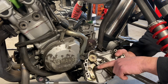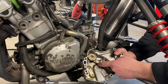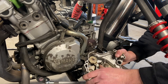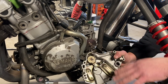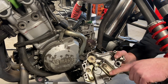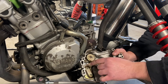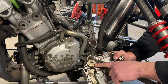On a hydraulic system with a master cylinder, if the pedal's all the way out, this is all the way in — you don't have to fuss with it. The only thing you have to mess with is how much your clutch releases. There's a lot of travel here, so you can overstroke your clutch, which is why I buy Tilton pedals that have a stopper on them. We know exactly how much play we're getting. We can push that clutch, check our throw, and set it exactly where we want it.